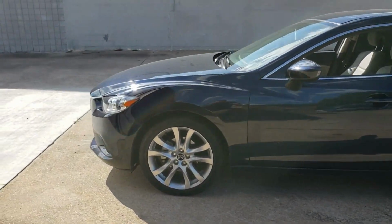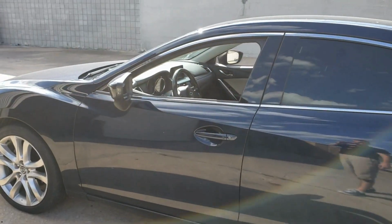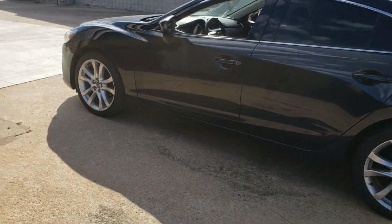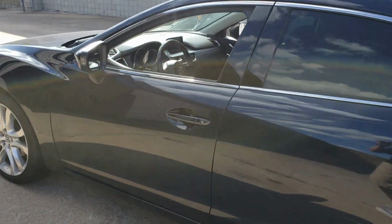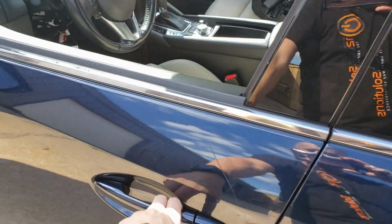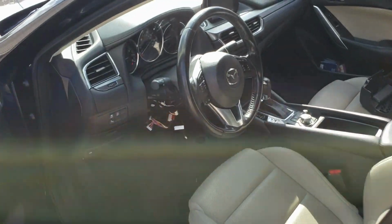During the remote start time, you're gonna have parking lights on, front and rear. So that way you have a visual confirmation if you choose to hook up the headlight connector that you saw during the video. When you guys are ready to come out and leave, simply press the unlock on the remote. That starts a 45-second timer for you to get in and do secure takeover. If you exceed 45 seconds, the car will turn off when you try to get in and drive away.